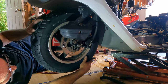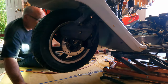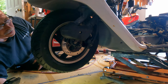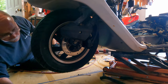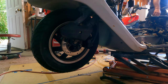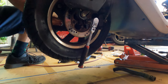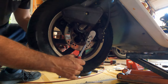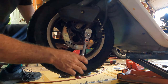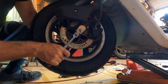And make sure it's in the groove over here on this side. Up on top, she's in the top groove. Alright, brakes are in. Bolts in for the wheel. We gotta tighten her up. Put speedo cable on. And we'll be done with that. We're back. Let's get some more done. Okay. We're tightening this front wheel. As we're tightening, we're making sure we still got good movement.